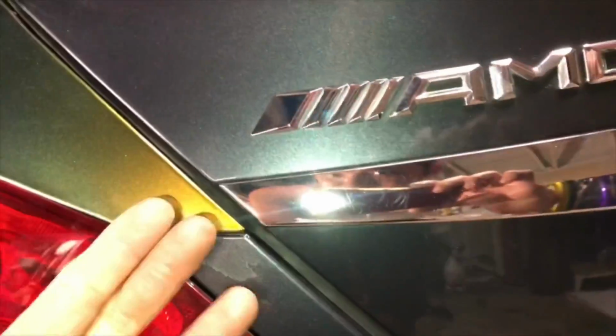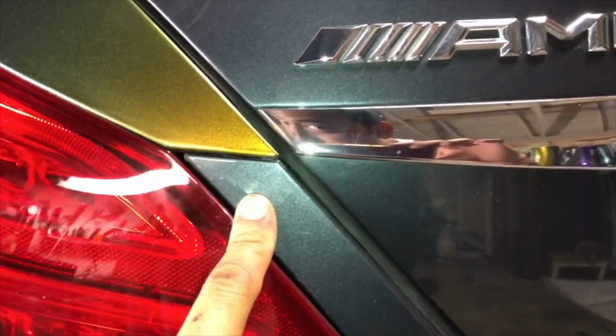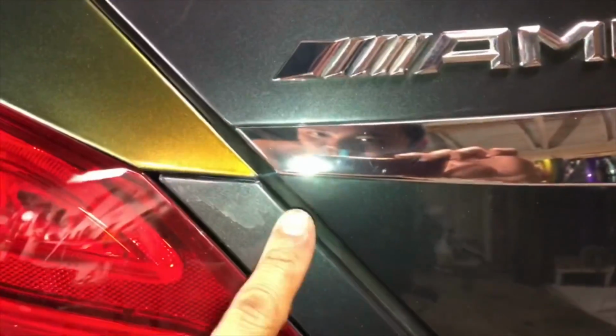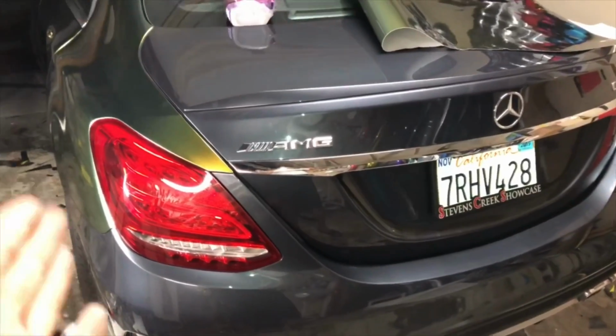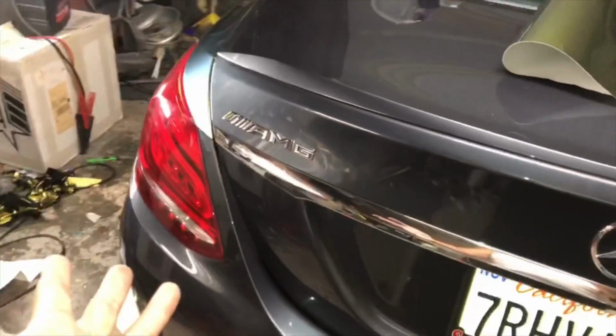Go, all right, what do you want me to do? You want me to sand it? If you sand it, then you won't see a difference between these two surfaces. And then you just wrap it, and it's fine. Whenever they get their car redone or whatever, they'll have to have it re-cleared, but then you have sanded this bottom coat as well. So it's either sand this to make it smooth, or don't sand it, wrap over it, and then you can see this. Whatever the case may be, I don't control how the clear coat behaves. I just tell you what happens when you lay wrap on it.